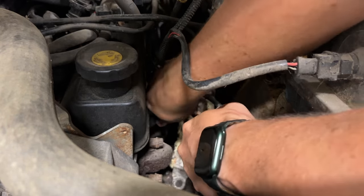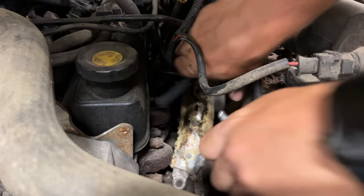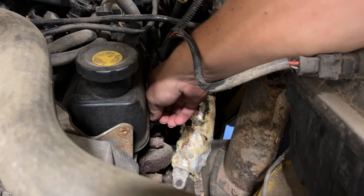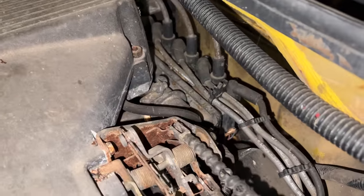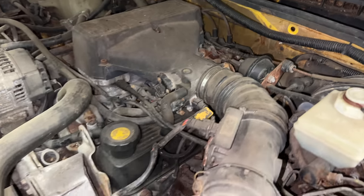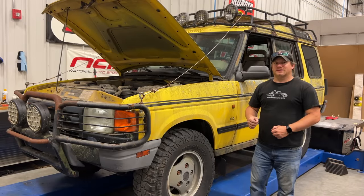So we seem to have found a British vehicle that has electrical problems. On a vehicle like this, the problem could be in a lot of places. This model of the Discovery is distributor-less — it has some coil packs back there and a little crank sensor that tells the computer when it should be firing. I'm going to have to stop it there for today, as diagnosing the non-start issue can be a video all on its own.